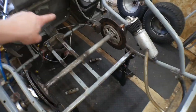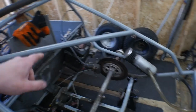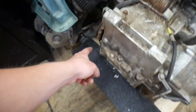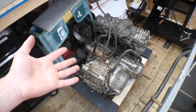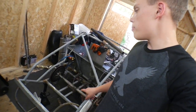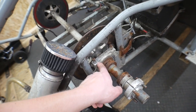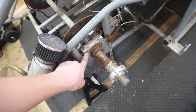I plan on using this as the base, running it across, then having a support bring it down in an L-shape with more supports underneath. Along that pipe running on both sides, I'm going to cut a piece of flat bar, drill a hole in it, and weld it onto the pipe, which will go into the two engine mounts. The length I need is seven and a half inches — almost like how the engine was hanging in the motorcycle, but now in the mini cup car.